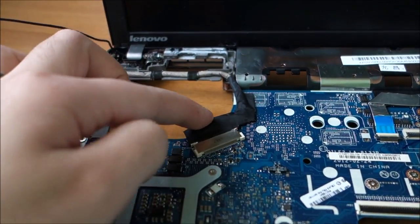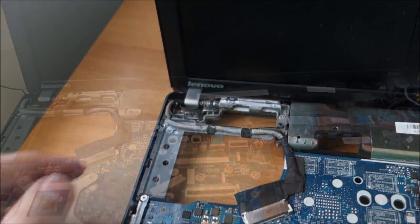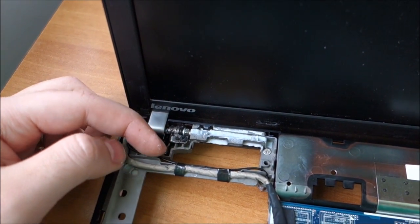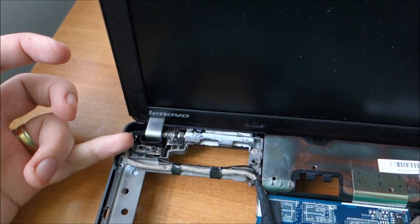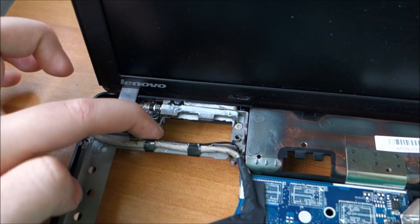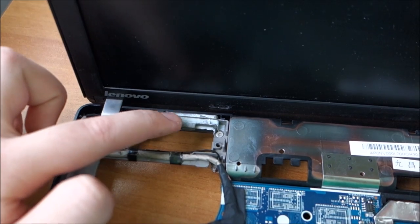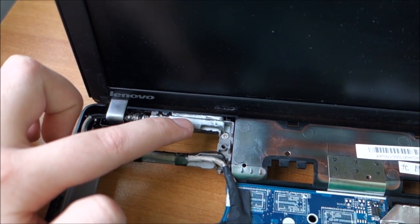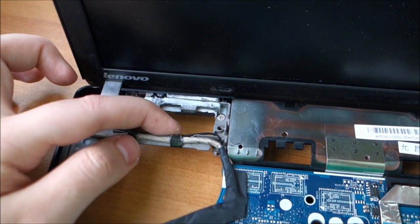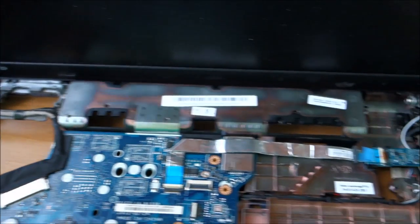And all seems good. Plugged in the display. It really seems pretty good. Cables routed. I decided to move the black Wi-Fi cable. One is Bluetooth, one is Wi-Fi, not really sure. But the black one, I decided to route it right through here, not to its original channel here, because this is occupied a little bit by the cloth with super glue, and I don't want to squeeze anything in there. It's better to put it here. Hopefully it will not end up being a problem.